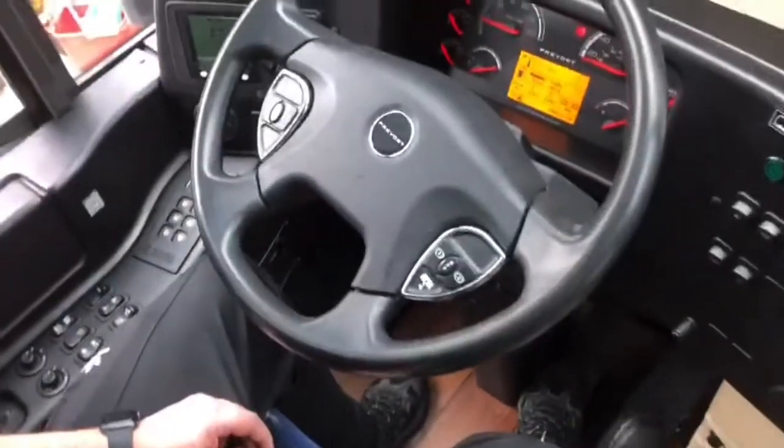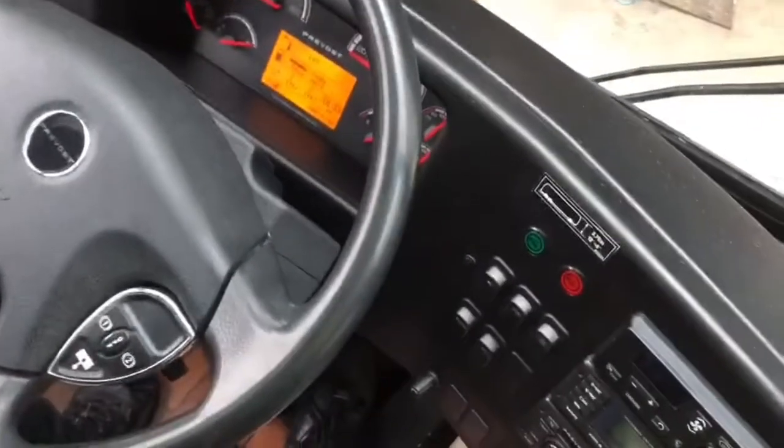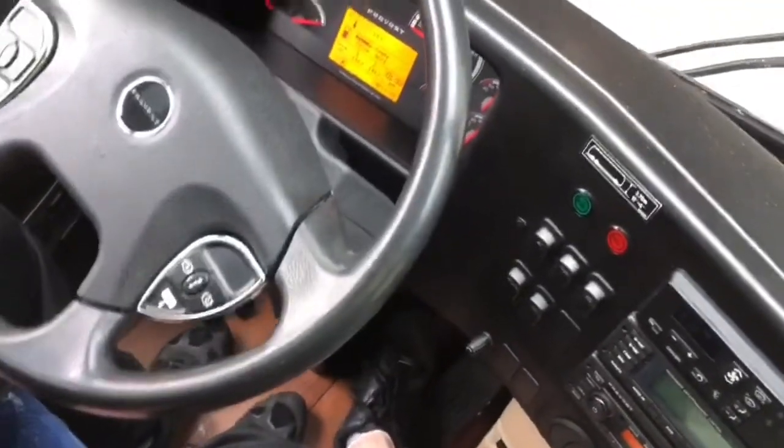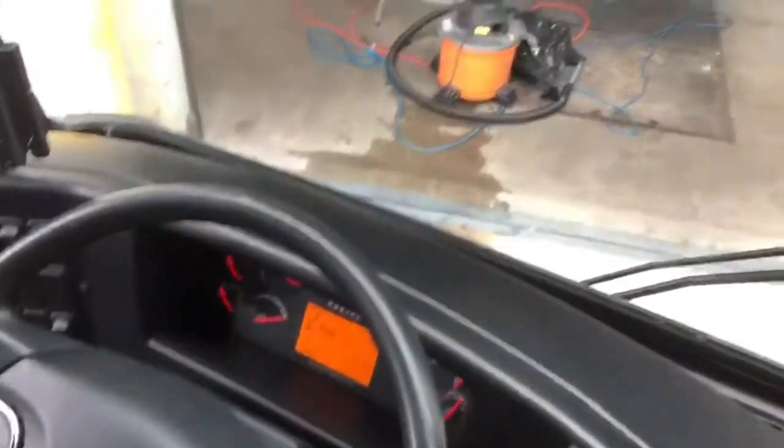You're going to have to try to get your foot in here and steer at the same time, perhaps move your foot over. Remember, an air brake system is pretty touchy, so you would have to be as gentle as you can. The main thing is just to keep the bus steering straight until you can get it to come to a stop.